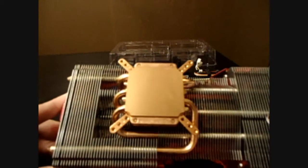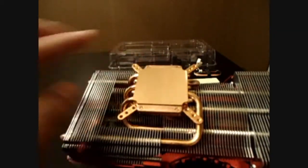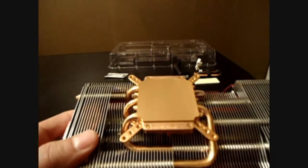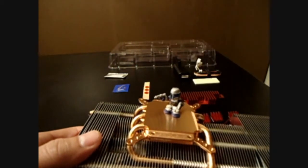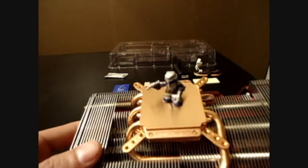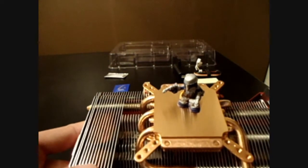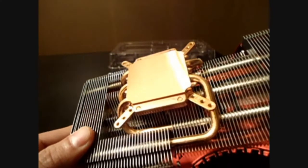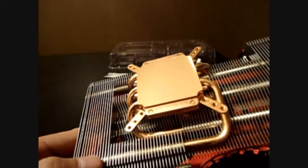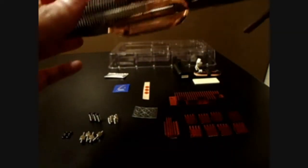Something I want to point out on the cooler: this surface is very, very shiny. In just the right light you can see some marking from a circular cutout or something, but for the most part it's very smooth. The FET surface is not a mirror finish at all — you can see a semi-reflection, but it's not a perfect surface. For the most part it's really good machining, so hopefully that will provide a good mating surface for the card.